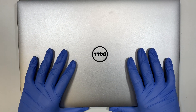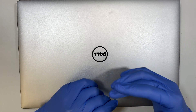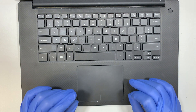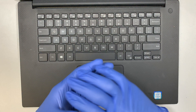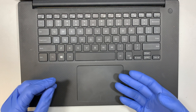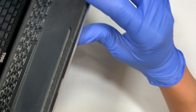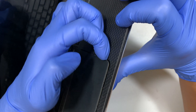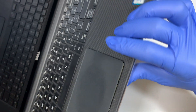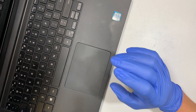Hi, welcome and I hope you're doing well. Here I have the Dell laptop, and in this video I'll be doing the battery replacement while also showing you what happened to the touchpad. The battery underneath the touchpad is swollen — it bulges and pushes the touchpad from underneath. You can see the touchpad is sticking out and prying loose, so when you press right-click or left-click it is not clicking at all.